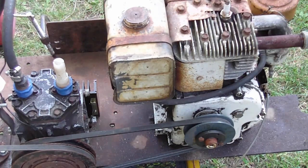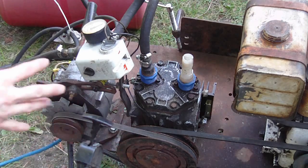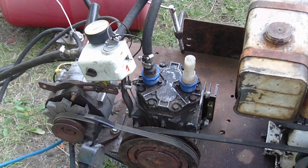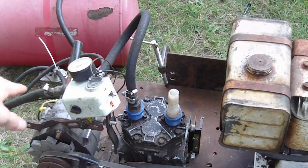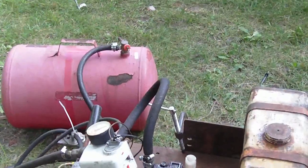The engine can run basically just off idle and I'll still be able to use the alternator. The compressor has an electromagnetic clutch, so all I have to do is connect 12 volts and it engages the compressor. I just need to put a battery on here, add a switch, and you can turn on the air compressor. It works through this pressure switch, which is set for 125 pounds — the clutch will cut out at 125 pounds so we won't overfill the air tank.